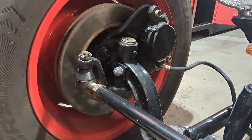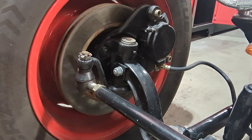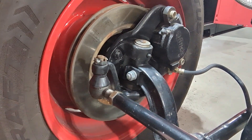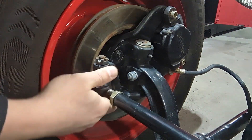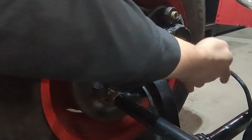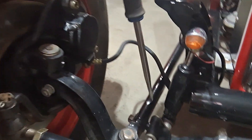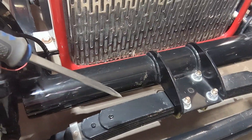Check the suspension and steering parts. The tie rod end we replaced was less than $20. Broken steering can lead to a whole new hot rod. This has a suicide front end — still looking at the same parts. There's a tie rod end, nice and tight, cotter pin's nice and tight. You got your king pin here and it's been greased. You got your brakes and brake line right there. Also look at your spring mounts and check those bolts — if this comes off, you've got a bad deal.